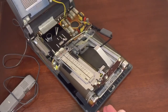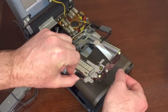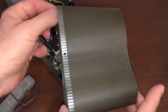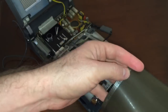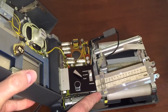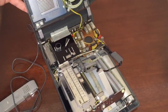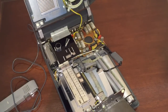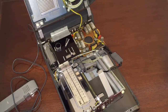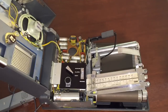To load the magnetic tape in, you lift this up, grab hold of the tape, and pull it out. It has the IBM name on the side of the tape. It's supposed to load with the IBM name here, and there's a little window you can look through to see that the unit is turning and that you have the tape loaded correctly — you can see the logo and the yellow and black squares appearing. Whoever owned this did not load the tape properly, so the material I'm going to play is on that side of it. It's very simple to operate: flip to listen or flip to record, and you're ready to go.